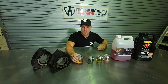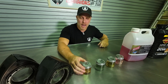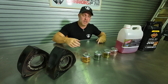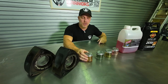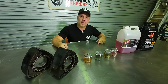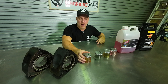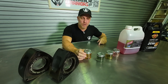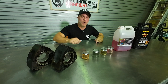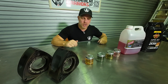98 is our highest premium fuel here in Australia on pump — it's pretty much at every service station — and this can be used for boost levels anywhere between 12 to 16 pounds of boost. If you're going to exceed those boost levels, especially in rotary engines, I would not recommend using 98. You need to jump up your octane level to combat the extra pressure you're pushing into the motor.